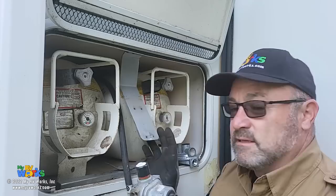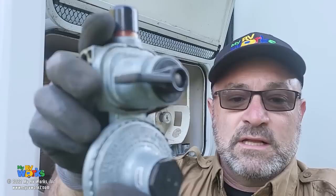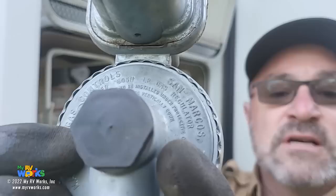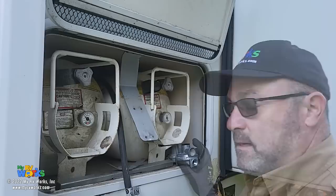Here is where the propane regulator is going to go - on this little flap that raises up out of the way when you pull the cylinders out. This is the regulator that came out. Watch - I'm going to pour this out. There it is - there's oil in the line. See right underneath there that little stain? That is an indication that this regulator has failed. When you do your inspections, look for stuff like that.